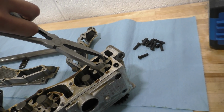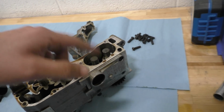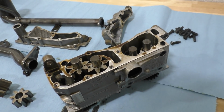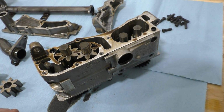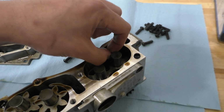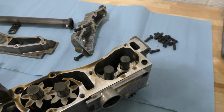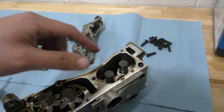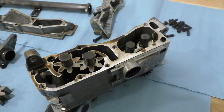The other two are press fit on. Those ones I don't even really need to take out. On the S-Class, they removed the whole thing, and I believe the chain doesn't go all around. But if I wanted to do that, I would have to go with a different, smaller chain, and also take out the press fit gears. I'm just not going to bother doing that. All I really need to do is take out these two gears, and now this scavenging stage will pretty much be useless. The oil from that stage will just circulate into this one, and it will always stay in this pump. It wouldn't really go anywhere. So yeah, that's all I really need to do.